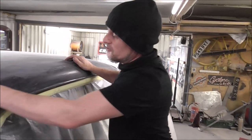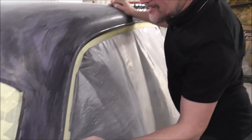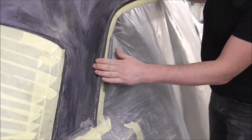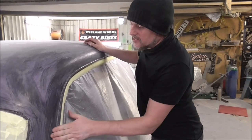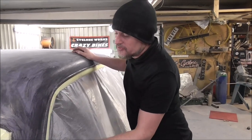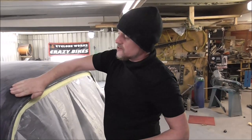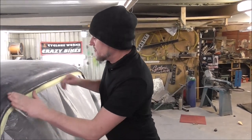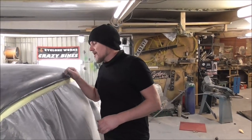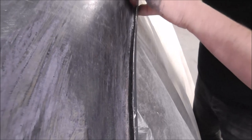This anti-rust primer is dry now. What we're going to do is a technique called snow ploughing, which was very popular in the 60s. It's where we mould this rain gutter into the roof to make a gentle sort of curve up, so the rain still comes off and drips down onto the body but doesn't just run down here anymore. It gives a much cleaner look because inside a rain gutter is always a bit rough - that's where the roof of the car is welded to the frame.